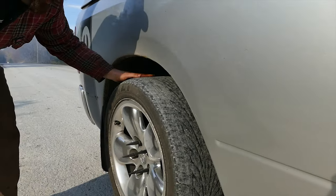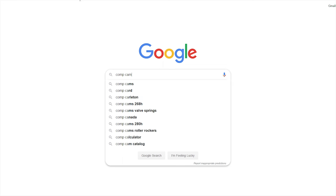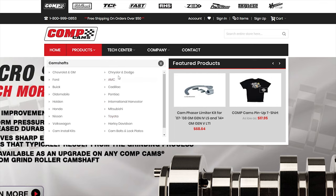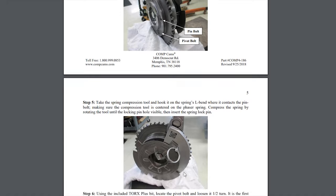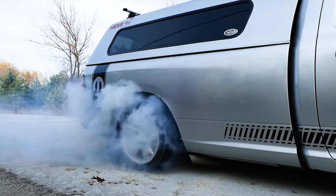There's just a number you go to, and that's another reason I liked Comp — they're like, this is what you need, everything else is up to you. When I had the thing apart, I put new valve seats in it, I did everything. Comp is easy as hell. For the variable valve timing, they've got all the instructions laid out. You put this piece on the front of your cam, the timing chain goes around, there's a spring-loaded mechanism for the variable valve timing. It's this finger thing — a block that goes on it — and you grab the spring, tighten the bolts, put a little metal block in there and loosen it off. Done. Blocked off the variable valve timing. It literally just binds the spring so it doesn't work.